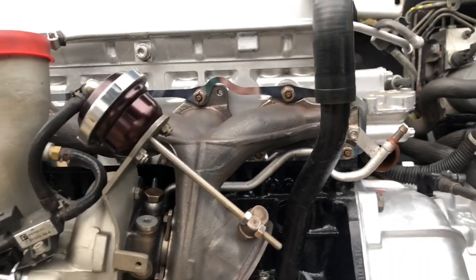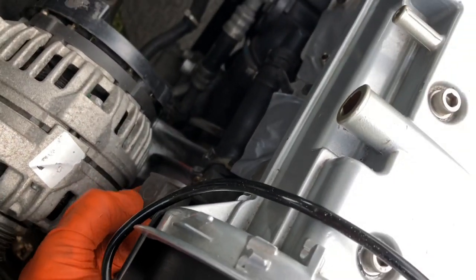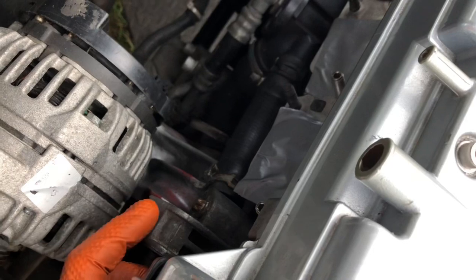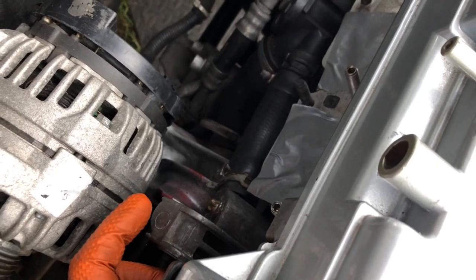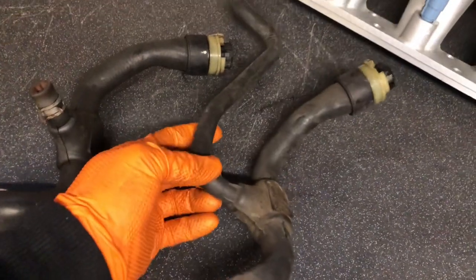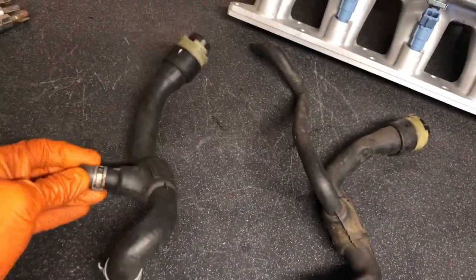With any heat or vibrations, aero nuts are absolutely reliable. On the water cooling side for the throttle body, on the Z20 LEH they're actually blanked off in the casting. So if you want to do it properly, get one of these from the Z20 LEH instead of just blanking off the Z20 LED one. On the water hose side I just bung it off with a bung - cut the hose so it's nice and flush without a big long length of water cooling line hanging around.